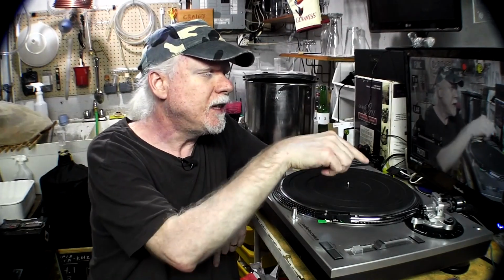This is controversial, and you can try it all the ways you want, but I think it's safe to say that if you just set it to what the tracking force is at, and then rely on your ears when you get this all set up to determine whether it's set up properly. If you're playing a record and there's high frequencies like cymbals or S's, and it's distorted in one side and not in the other, then you might want to try adjusting the anti-skating. Because what happens is when the stylus is tracking inside the groove, if it's tracking heavier on one side than on the other, then you can get differences and you can get distortion in one side and not the other, on the high frequencies especially, which is called splatter. So if that happens to you, check your anti-skating settings and see if adjusting it makes any difference.